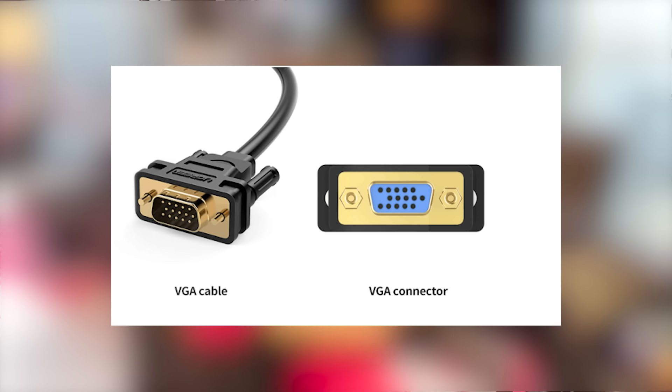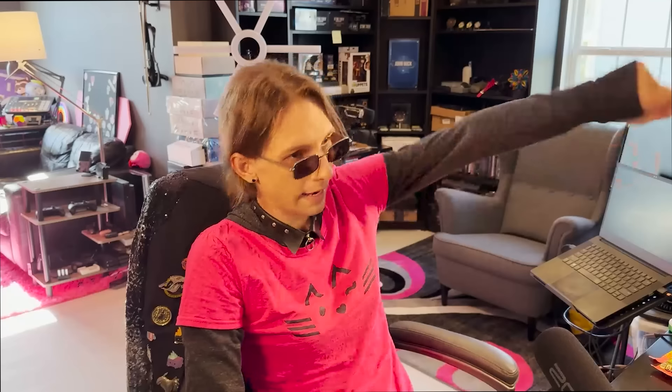Yeah, it is upside down. It's a trapezoid and the wider part is supposed to be at the top of the port. Motherboards are mounted from the other direction where the direction that you can see the IO shield text is upside down. The entire thing — how did you do that? Because I thought that was attached. You can see the slope right there. The reason this is important is when you go to plug it in, all the pins are going to be misoriented. You can't even use this port.